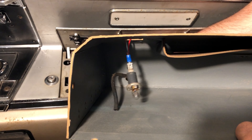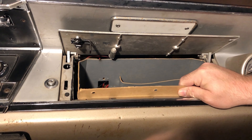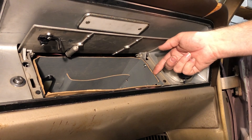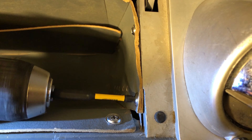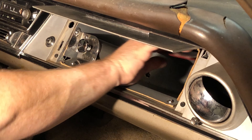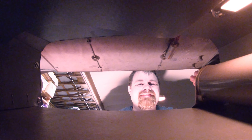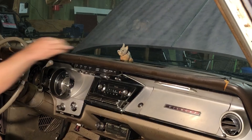The light is pushed through, and then the vacuum hose. I had the best luck installing the glove box by turning it sideways and then straightening it up. The glove box light is secured by two screws. The reproduction missed a screw hole, but DeWalt gladly makes a new one. The optional trunk release is installed and tested, and I toss my registration and insurance cards in my favorite spot. I test the mercury switch and it turns the light off just like it should. Last step is to put the lucky schnauzer in place.